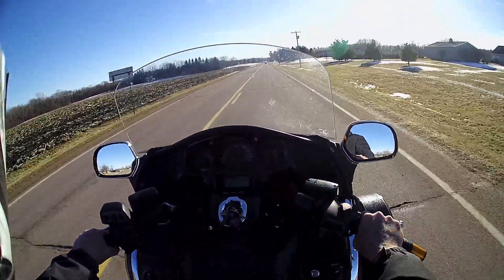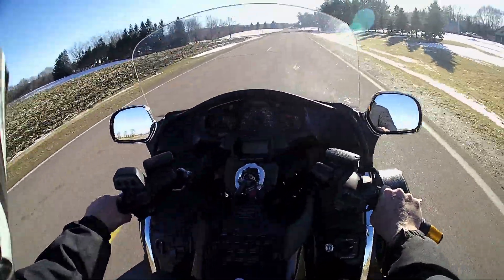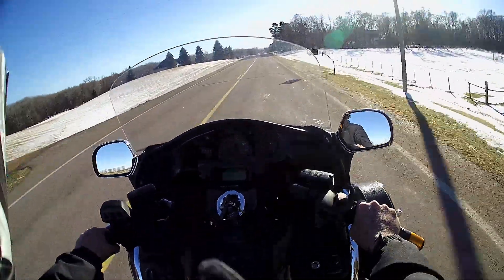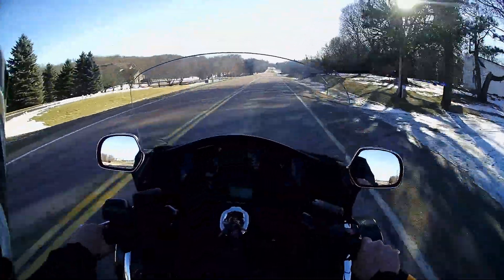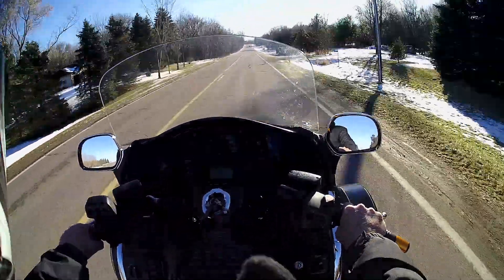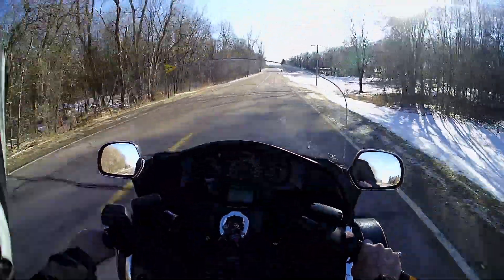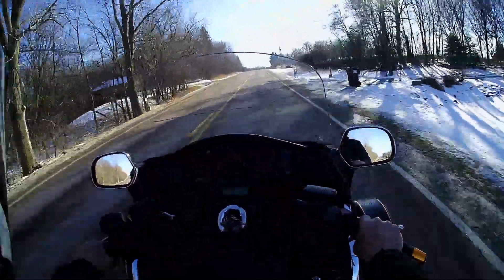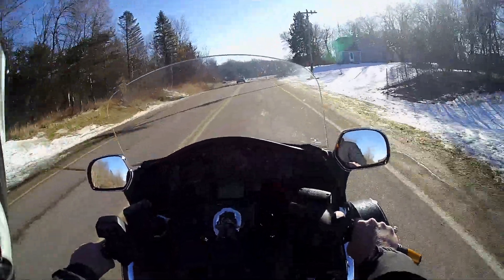I end up doing a lot of research trying to get correct tires. These are Achilles tires, which I just switched to, and I like them — they're a very narrow tire, which is kind of mandatory. The smaller the tires on these things, the better they handle. If you look at the Can-Ams, they've got a very narrow tire, about four inches wide; these are about five. A lot of guys are going with 17 and 18-inch low-profile tires, but I tried some that were just an inch wider than what I have and you could barely drive the thing. Tires are a big deal — it's part of the geometry, and there are a lot of technical reasons why tires don't work. It's just part of the research you get through in the seven or eight years you do these kinds of things.